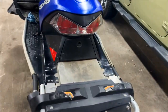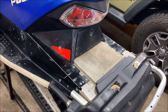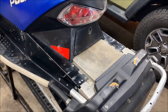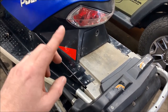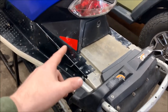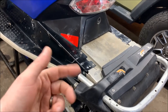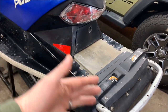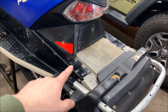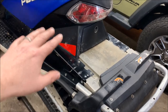Another thing that was done: if you've ever owned a Fusion you'll notice that sometimes they run hot, and it's because of the location of the cooler. When this sled was extended out the 10 inches for the 136, the heat exchanger was actually slid back to aid in cooling. We'll talk about that more when we actually take it apart.